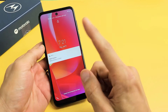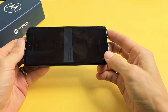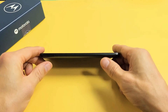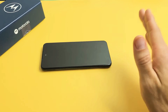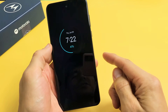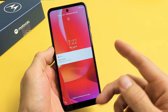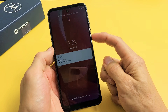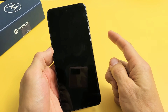If your phone is still stuck in a boot loop, the next method is what I call the freezer method. With your phone naked — no case on it — put it into your freezer and leave it there for 15 to 20 minutes. After that, grab your cold icy phone out of the freezer and tap the power button to see if you're out of the boot loop. If still stuck, press and hold the power button until you see the Motorola logo appear, then let go.